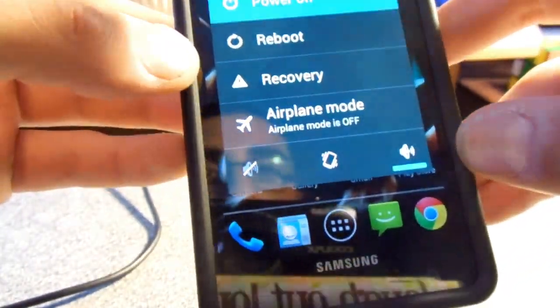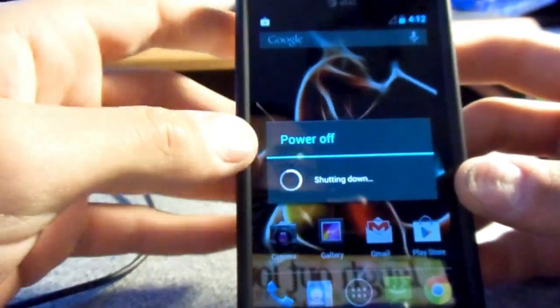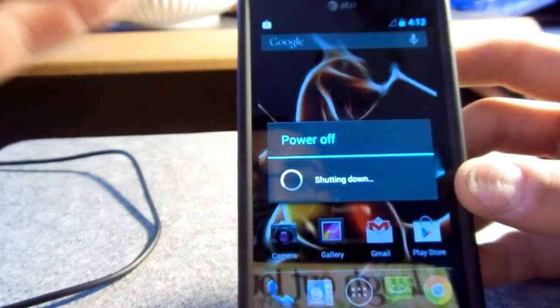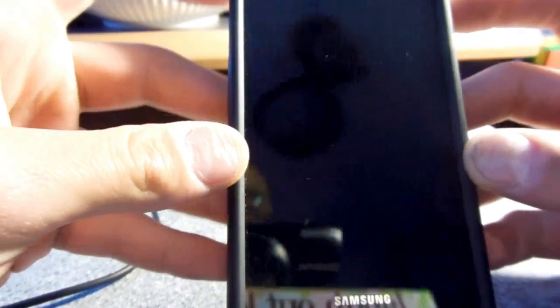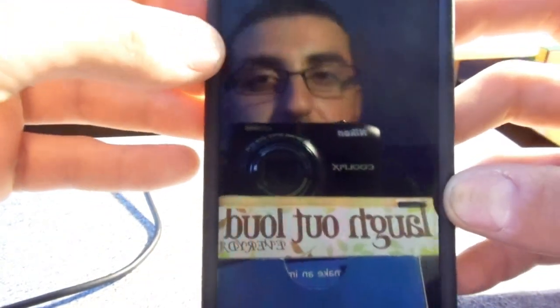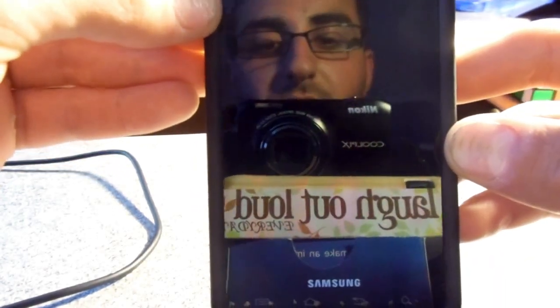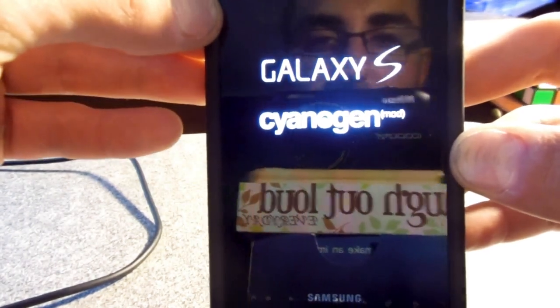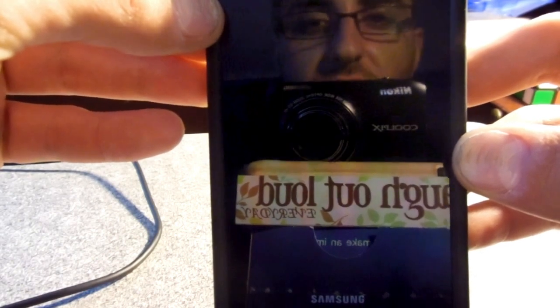Remember, this is after you have installed the rooted Gingerbread, or the CyanogenMod for whatever version. As long as you have CyanogenMod and ClockworkMod, you can follow these steps. Part one of my last video covers this. Hold both volume up and volume down buttons at the same time, then hit the power button. When you see the logo, let go of volume up and down, and it's going to pop up with this. We should load into the bootloader.